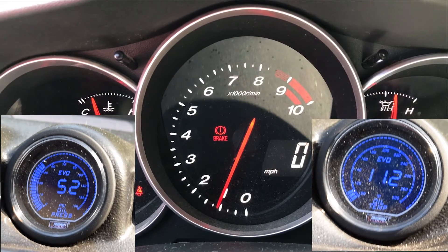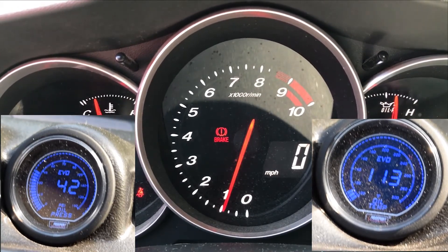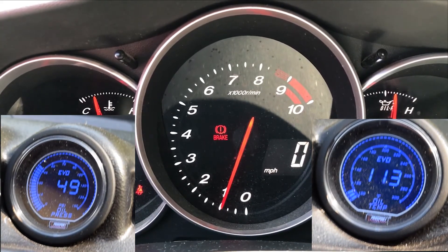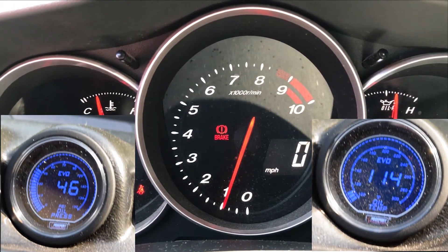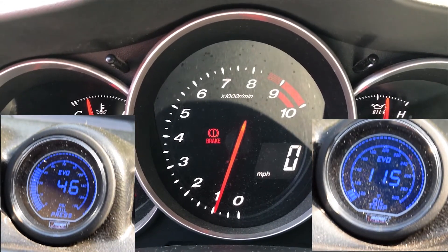Back down to about where it is — it hasn't dropped to warm idle yet. There it has, just a little bit below a thousand. It'll jump between 750 and a thousand. Sitting about 40 PSI there; eventually it'll drop a little bit more too. Once the oil temp reaches 180, I'll check in again.